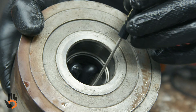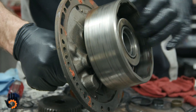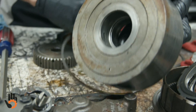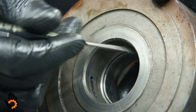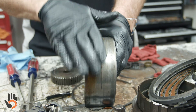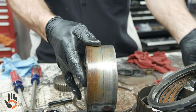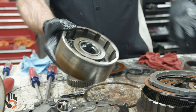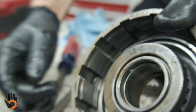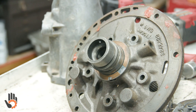Clutch drum — we want to look at the bore here where those two sealing rings ride. That's the two rings on the back of that pump. We want to make sure those rings have not done damage. Make sure a pocket screwdriver won't stick in anything there. A lot of times I'll just clean that up with a little Scotch-Brite or a little bit of sandpaper. The outside of this drum does have some rust, but I can wipe it off with my finger, so that's okay. That's where our band rides, so we clean that up a little bit. There's a bushing inside here — a very critical bushing. You definitely want to replace that. It supports it on the back of that stator support so it doesn't rock around too much and cause ring wear.